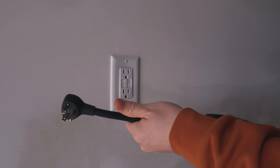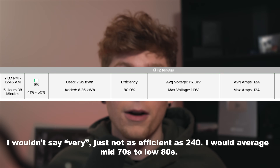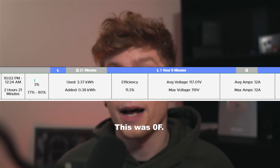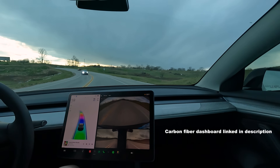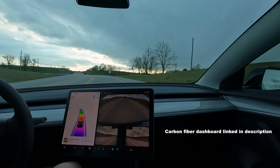I'm going to be referencing the zero to 100% time quite often. In reality, you're never going to be charging zero to 100% — you're really going to be charging between 20 and 80. But zero to 100% time I feel is more digestible and easier to make comparisons with. Now I charged off of a 5-15 for the better part of a year and a half, so I have quite a bit of experience with it. It's going to be very inefficient, so the amount of electricity you actually use versus what makes it to the car. Secondly, if it gets super cold out, the car might not even charge because it has to use energy to keep the battery warm, which is going to eat into the amount of charge you're able to recoup. And third, going on a long trip with short notice was pretty much impossible without the use of public DC fast charging.